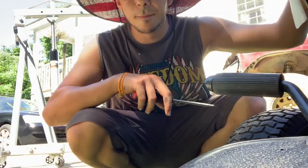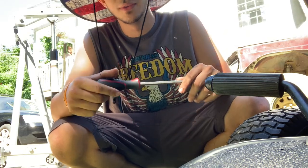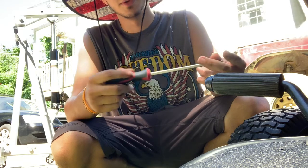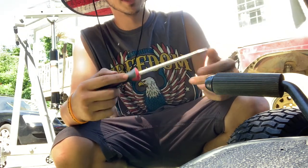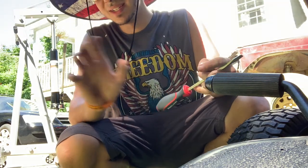All right, so I'm just gonna start using a regular flathead screwdriver to get off all the heavy rust chunks that are on the front of the engine block. And then after we do that, I'm gonna spray the engine cleaner all over the really greasy parts. I'm gonna let that sit. I'm gonna scrub it with a Scotch-Brite, and then maybe this plastic scrubber I have.